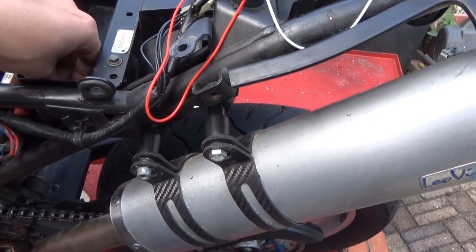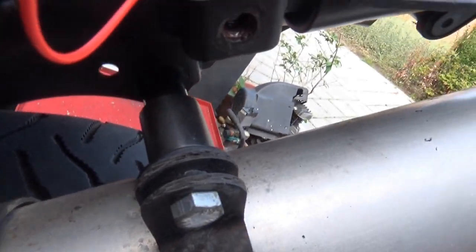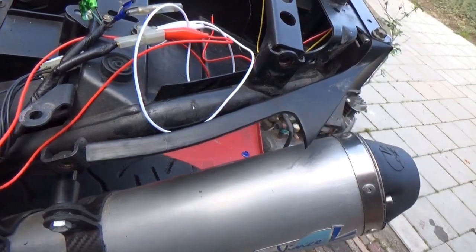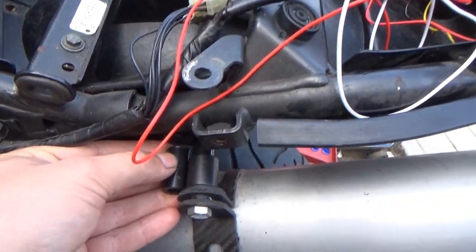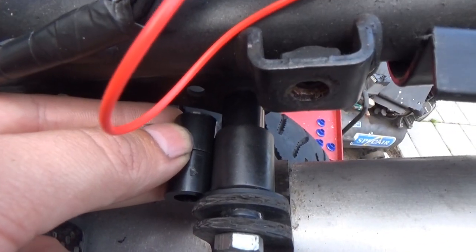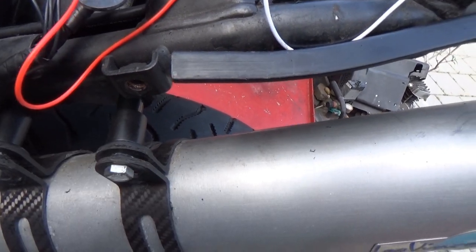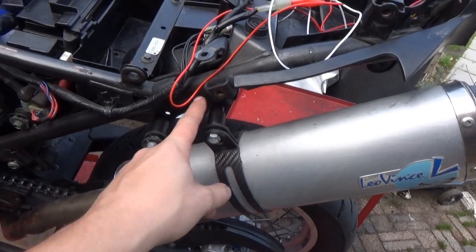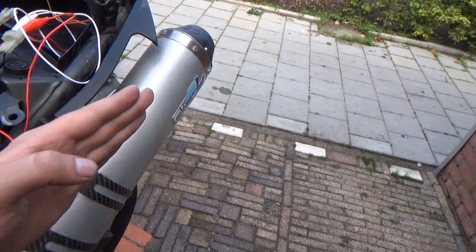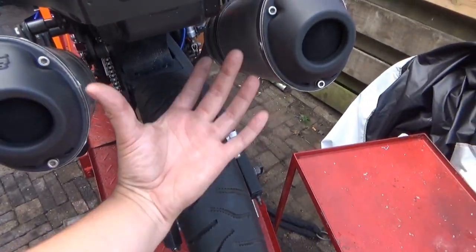I have found these small ones — they fit perfectly. But you will get that look: one big, one small. I don't like that. Two of the small ones is about one and a half of the big one. I am going to measure two big ones next to three small ones. Whichever is longer will go back, whichever is shorter will go front, to give the exhaust just a small angle, which will create space for the license plate down here.